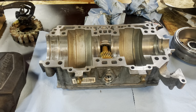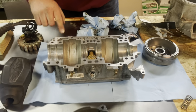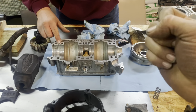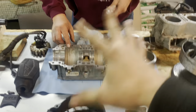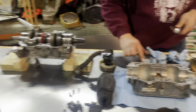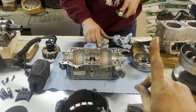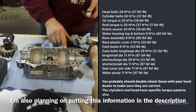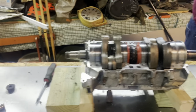He's going to spread the Honda bond into those holes and put down a nice consistent thin layer. What we don't want is for it to break — if it's allowed to suck any outside air into the case, that mixes with the fuel improperly, changes the fuel pressure and fuel ratio, and can heat up bearings and cause things to go pop. So he'll lay that down thin with his fingers, then we'll put the two halves together. We're going to tighten down all the bolts according to my documentation — 21 foot-pounds. Pay particular attention if it says inch pounds or foot pounds on the bolts you're installing.